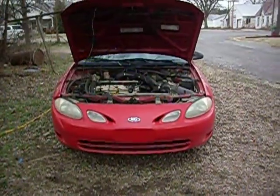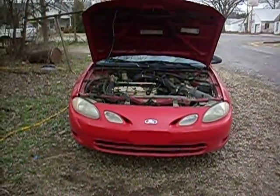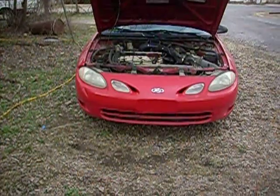So we're going to do a little diagnostic to try to determine if this is the case. I've already done the compression test on it, and there are our compression readings. I suspect that this cylinder is where we're losing our compression, since it's got between 100 and 110 PSI, whereas the rest are 120, 130, somewhere in there. So we've already done a compression test.